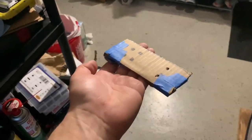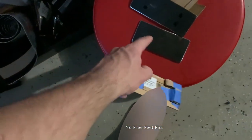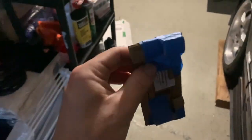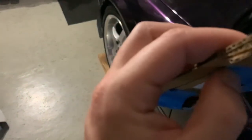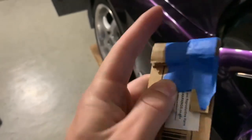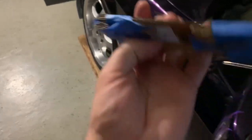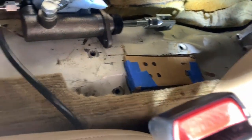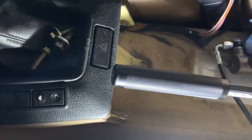I spent most of the time making this — it's a template. I got a piece of steel already, and this is gonna help me cut pieces out to get the height I want. I made a cardboard template that fits in there nicely. I stacked two to three layers this way, a fourth and fifth on the inside, and a bunch on the back. So it'll sit right here with some tilt so the handbrake lays nicely with clearance — not hitting. I'll move it over to this side and it's not going to interfere with shifting at all. You can see the holes for the trim.